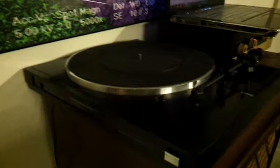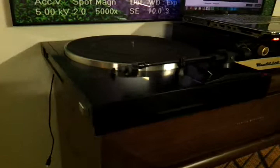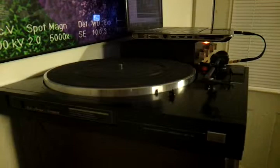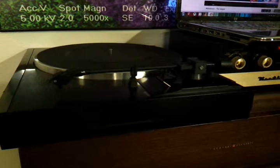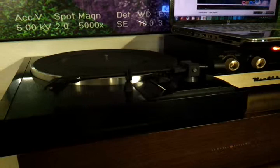The reason I got it: I've been hitting up pawn shops and junk stores to find a good one for a while. I went into a pawn shop today and said 'got any turntables?' and they said no. I said, 'well, what about those two on the floor covered in dust?' — 'Oh, they don't work.' So I looked at them anyway, and this one looked salvageable. The guy plugged it in; it didn't spin, and the arm just kind of wobbled. I figured maybe I could fix it, so I paid all of $5 for it. The turntable didn't spin because the belt had come off — it's belt drive. And the arm was wobbly because one of the little plastic joints underneath had cracked. It was a brace against a metal pin, and the pin was just spinning freely where that plastic was supposed to be holding tight. I glued it down with some super glue and everything seems to work.